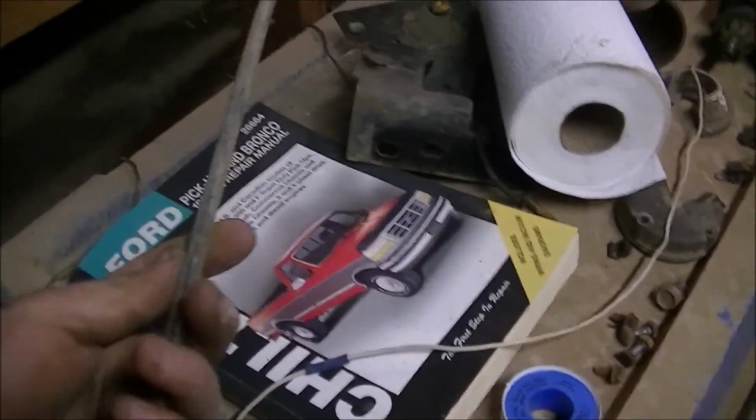This is actually the lever where this clutch lock rod went. So I'm pretty sure this spring would have bent this rod anyway, but I'm not really that worried about it. It's a lot of tension to pull this back, but the belt really doesn't have a whole lot of tension because, like I said, it's infinitely adjustable. Let's see, I'll push on this pedal with my knee.